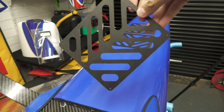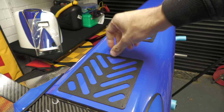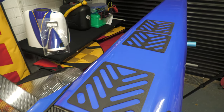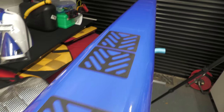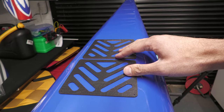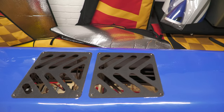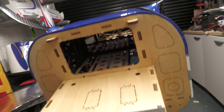Before we mount the motor and the ESC, I'm going to open up one of these cutouts here for airflow. If the ESC mounts here, we're getting air going through the hole here. Along the back section, I'm going to open up a couple of holes for ventilation as well. These are pre-cut really - just cut the covering through, then drop these vent covers on and screw them through. They're already cut out to look quite nice. I think what I'll do is just do the rear two together so the airflow flows through nicely, and leave the front one - the idea being air comes in at the front and exits through the rear two vents.